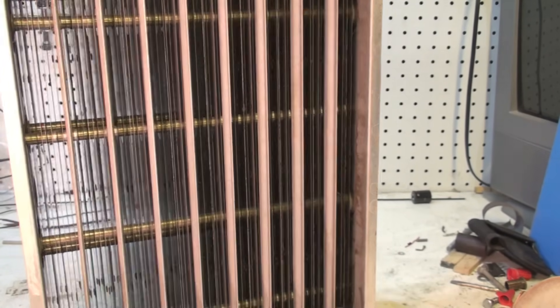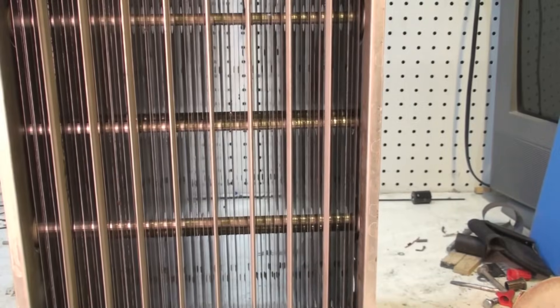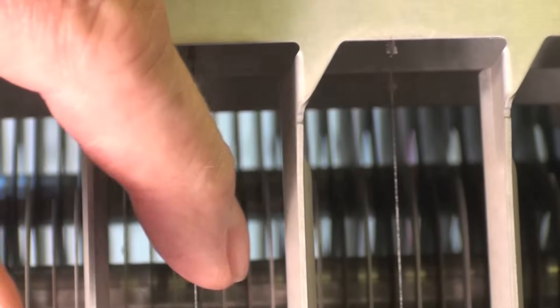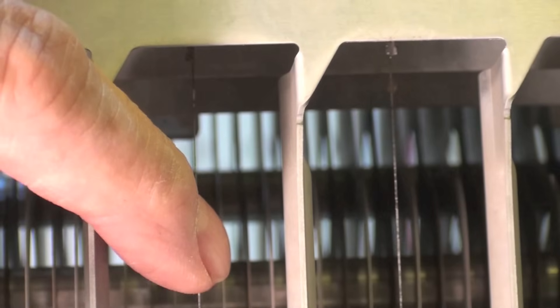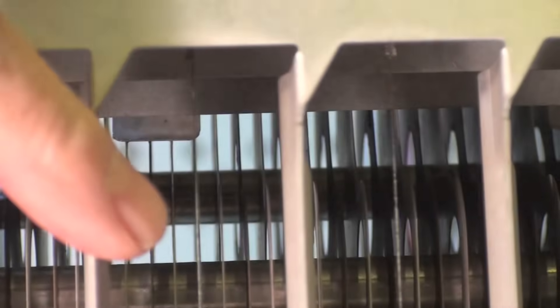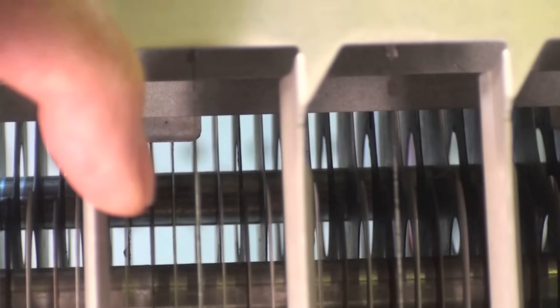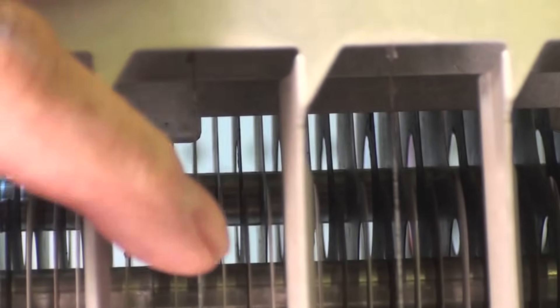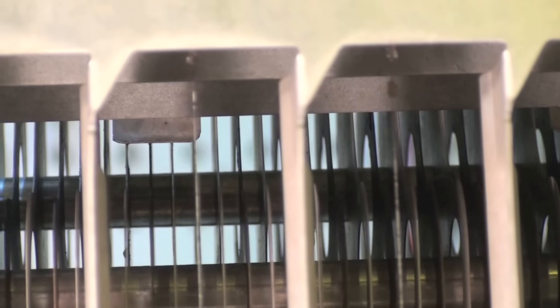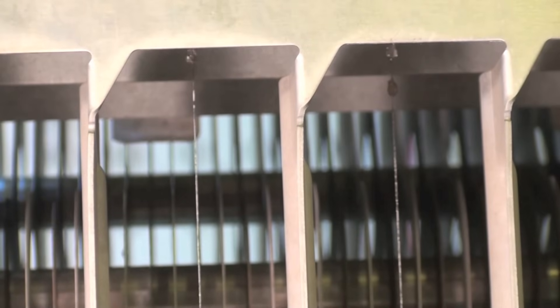Here's the cell when it's clean — obviously there's no dirt on it. One of the things you should be checking for is these wires. These are the ionizing wires; there should be one between each one of these plates. You can buy replacements — they're usually gone or broken because somebody got aggressive and used brushes on this.